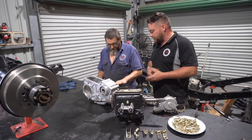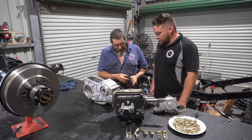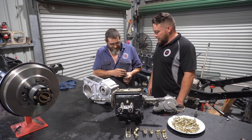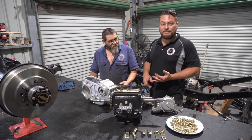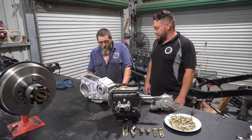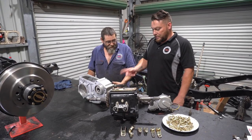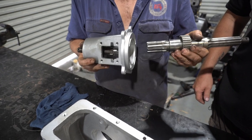Here's a cool fact: this is an output shaft, and the needle cage roller bearing in here goes all the way to the right model five-speed — same place, does the same job. Even though the gears and everything are different, they use that exact same needle roller cage. You just slot the output shaft straight in and it's perfect. To build this gearbox, we've opened up four or five gearboxes just to get bits like the thrust washers for the idler gear in good condition. It's been epic.